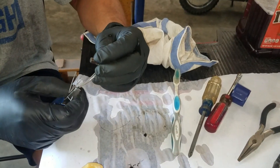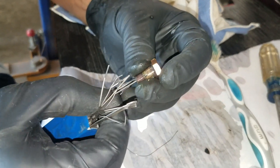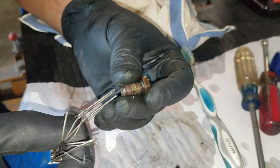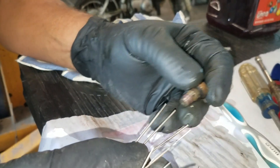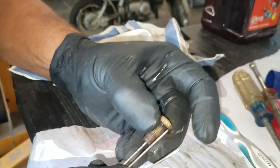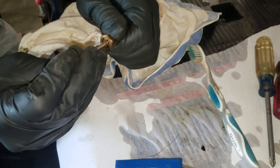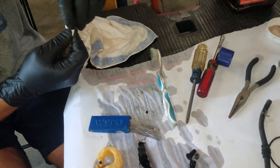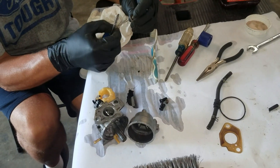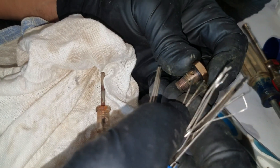I'm going to take this and gently with a wire brush make sure all the crust and old fuel is off. Then take my little tip cleaners. This first hole just allows fuel to run through — this isn't your fuel jet. I'm just making sure there's no leftover gelled-up fuel in there. Now I want to do these side holes on the side of it and make sure they're all good and clean. If your fuel can't go through here, it's not going to run.